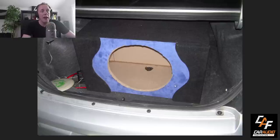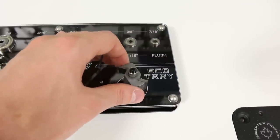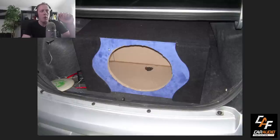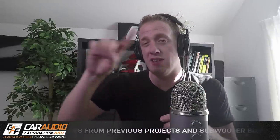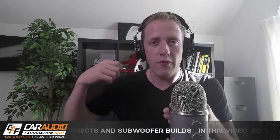Something else I noticed: if you look at the subwoofer cutout hole itself, the suede is a little bit jagged where it's cut. Not a huge deal once the subwoofer is installed, but what I would do differently today is use a router rabbeting bit, riding the bearing along the inside of that circle to cut a groove about three-quarters of an inch out — making a slightly larger circle. That groove gives me a perfect step to run my razor blade in to perfectly trim the suede in a circular fashion. It also removes the suede from the wood surface that the subwoofer mates against, which is important — I want the subwoofer gasket to seal against a hard, flat surface for a perfect seal with no air leakage.